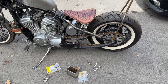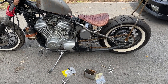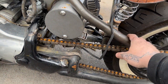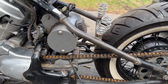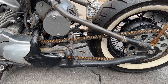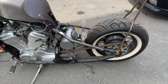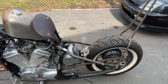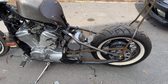Got some work on the bike done in the last week or so. The chain's a little rusty from sitting out in the rain, same with the tanks — I'm gonna have to sand them down. But I got the hardtail conversion done, got it all in there welded in, and I welded the seat posts on today. My welds are not the prettiest but they're effective — hit it with the hammer and they didn't break. I tried to tack on the bracket for the rear fender but I'm gonna have to pop the rear tire off to do that.